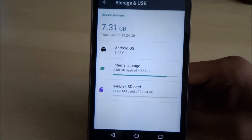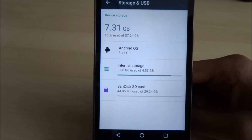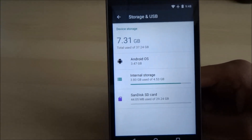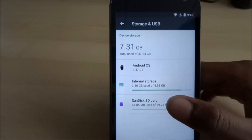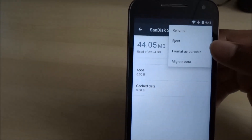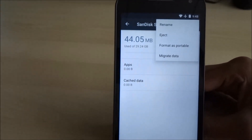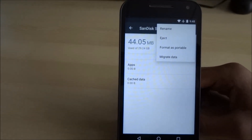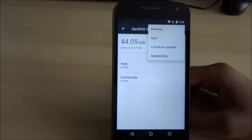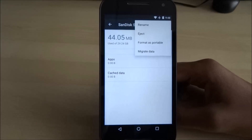So it's not saying 40GB, but I'm assuming you can easily shift stuff onto the SD card now. So how do you reverse it back to how it was before? You click onto the SD card name, click the three dots, and then Format as Portable Storage. So if this doesn't really work for you, you can just roll it back again like that. But again, if you're making these changes, just make sure you back up what's on the actual card itself.